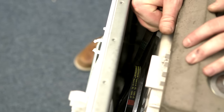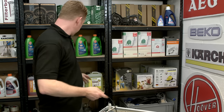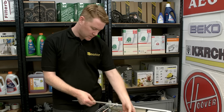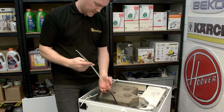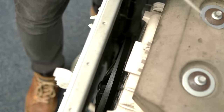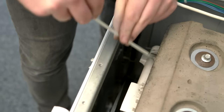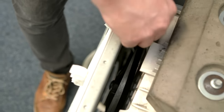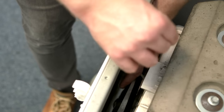As you can see, the belt is still trying to come off the pulley, so I'm going to move on to the third and final technique: using a cable tie. I'll attach the drive belt to the drum pulley using the cable tie. I put the belt on the drum pulley, put a kink in the cable tie so I can reach the end, feed it behind the drum pulley and out, then tie it nice and tightly so it holds the belt firmly in position.